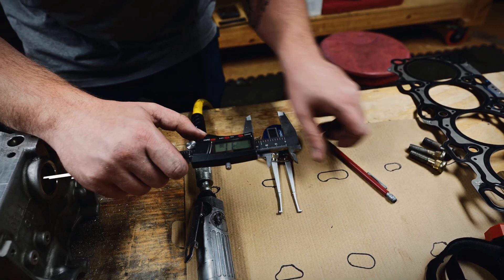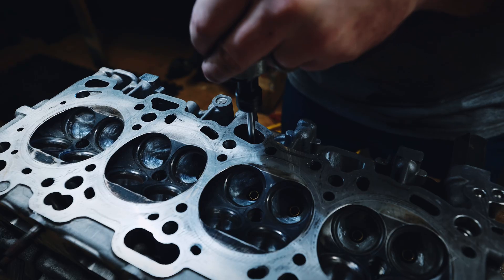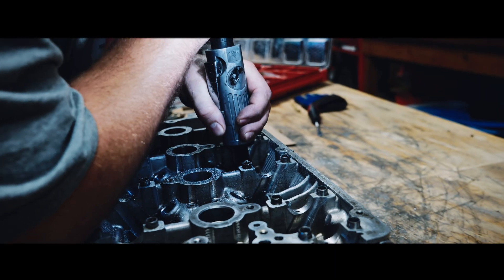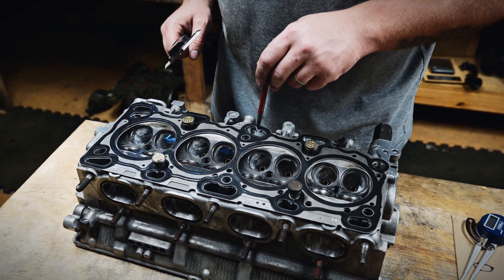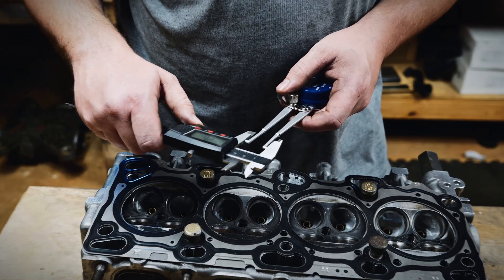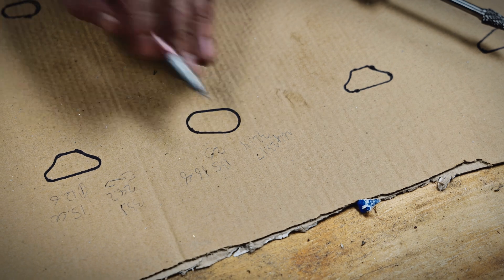The upper half of the length is 32.18 millimeters and down in the hole is 23 millimeters. Down in here we're almost at 17 millimeters, so we've gotten rid of the majority of the taper to almost a maximum 20 millimeters of width up top. The length is now 26.4 millimeters, so we've opened it up about four millimeters and we're getting closer to our 32.